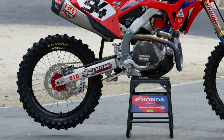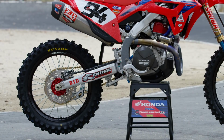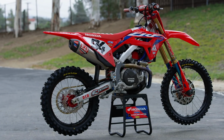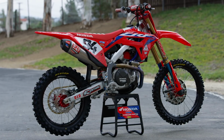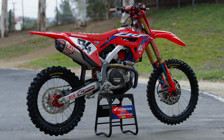The linkage and bell crank on this motorcycle are made completely to HRC specifications, something they've been targeting for the last year with this chassis, and now that they have the 250 guys on it, they've learned kind of the same thing even on that end with the Lawrences on it, is the guys are looking to get the bike to squat a little bit more naturally. They don't want it on throttle to climb out of the stroke as easy. They just want it to a little bit more subtly settle into the stroke. We know that is one of the goals they're trying to accomplish with this different linkage and bell crank. And beyond that, they're probably changing the middle to end of the curve as well to suit their specific suspension needs.